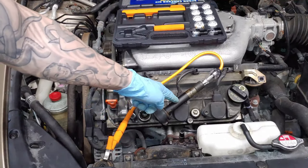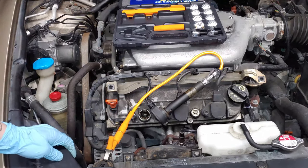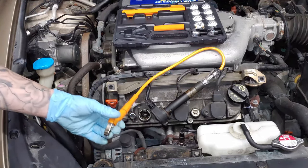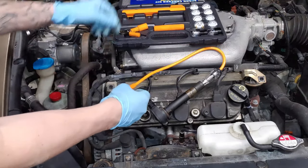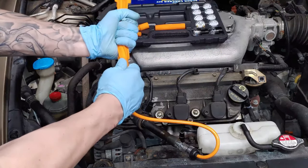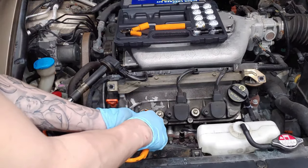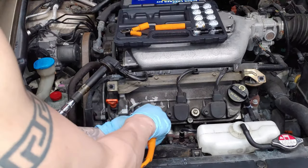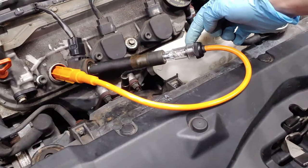Our wiring and our coil both came back good. The last thing to check is the spark plug. We move the clamp out of the way and take this spark plug testing tube, plug it up to the male fitting, then shove the testing tube down onto the spark plug. With everything hooked up we'll kill the light, start the car, and watch the bulb.